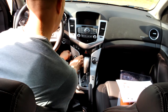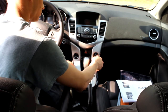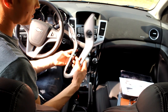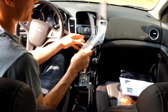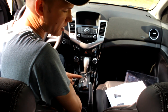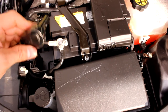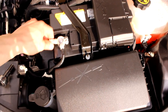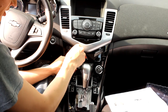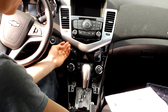So we got that off. You want to unclip the wires on the back. Now we want to disconnect the negative from the battery cable, so I'm going to go into the hood and do that. Use a 10 millimeter and disconnect it.